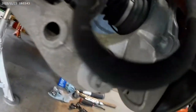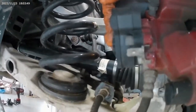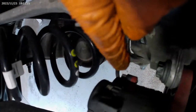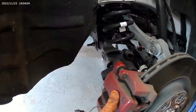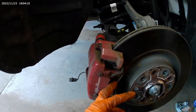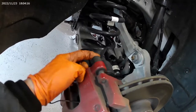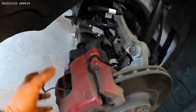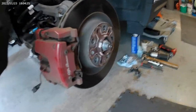Next up, push that harness out of the way off that clip. Your parking brake actuator has an O-ring on it that goes into the caliper. There's a 5mm here and a 5mm on that side right there where my finger's pointing. Pull those off, and then you can take a screwdriver and kind of pry this guy out — pretty simple. The other part you need to do is undo this faceplate just for ease of use, this pad retaining clip, and some 7mm allens for the slides, and everything comes out.